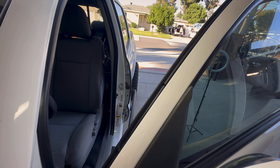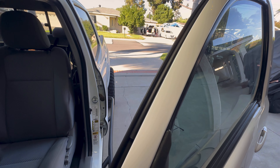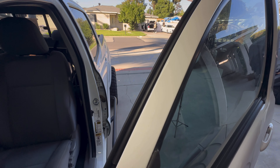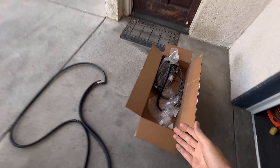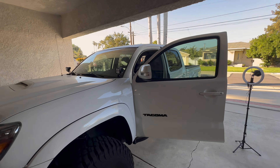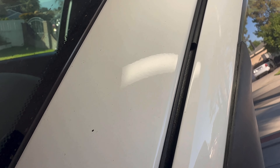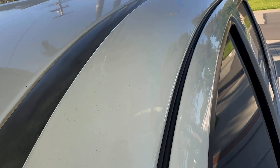I am double handing this, but you see that little tube right in the middle of the screen? That is the actual fix of the TSB. You can follow it all the way up. If you look at your seals and you have that tube, these are the upgraded seals already. If you don't, you're going to have the stock ones with no tube — and you can see it right there, no tube all the way down. I'll post the part numbers in the description below so they're documented for everyone. With the door closed, you can see the tube going all the way up and over.